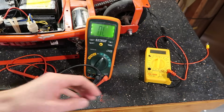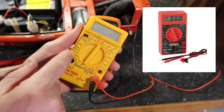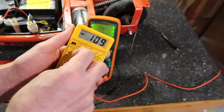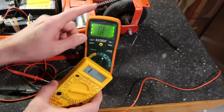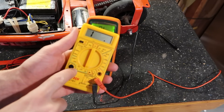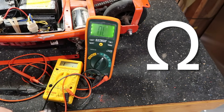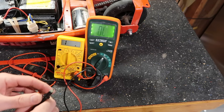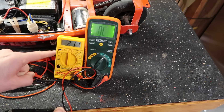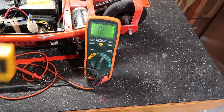But if the wire is good you'll hear a beep, and if you hear that you know there's continuity. The cheap meters at Walmart will look similar but red, and they're a little nicer, but still not worth the money to me — I'd invest in a better one. I'll put links in the video description. Down at the ohms setting there's a little horseshoe — that's the ohm symbol — and you can check the display. If I hit these contacts together it'll change, so you'll know there's a good wire with no break in the line.